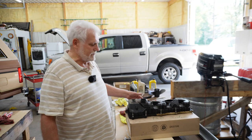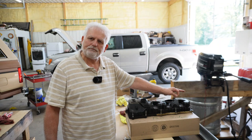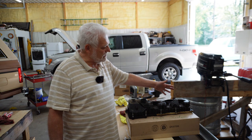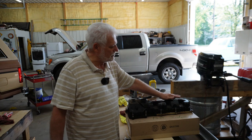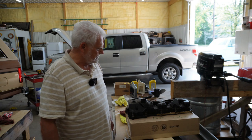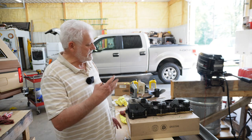Then I had to go at it and put this all back together. I had to take this off again — I didn't have to take it completely off, but the plug I couldn't get loose and I was afraid I was going to break it, and I couldn't get my coil pack in there. I could get the plug in okay but couldn't get the coil pack in. So I loosened this up a little bit and had to take the lines loose. It wasn't very fun, but I was able to get that coil pack in. I put that all back together, bolted everything down, started it, and it ran perfectly. The only clicking noise I heard was in the belt, which it had that to begin with. I've driven the truck maybe a dozen miles since doing the valve covers and things seem to be working just fine.